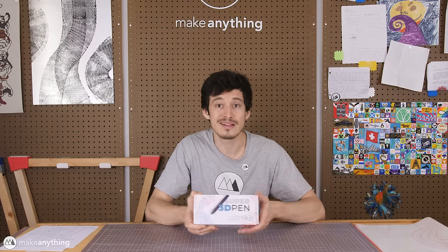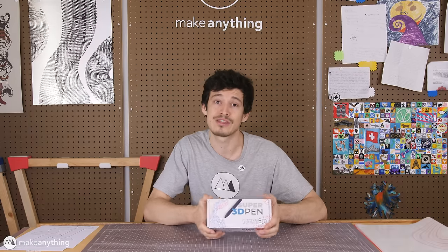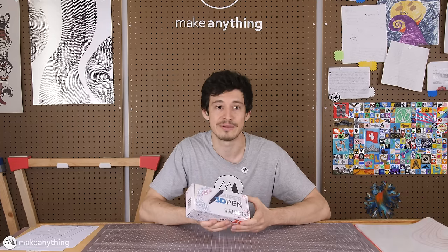If you've seen my reviews for all the different 3Doodler pens, I think I've tried them all. Well, I like them. I really like them a lot. They're some of my favorites, some of the best on the market. And my only constant gripe with 3Doodler is that they're using the 2.85 millimeter filament, which isn't as common and accessible as the 1.75 millimeter filament that I use with most of my 3D printers and most of my 3D pens. So I'm really excited about the Mynt 3D pen because they're using 3Doodler's awesome technology, but their pen also takes 1.75 millimeter filament.